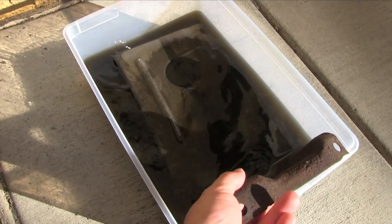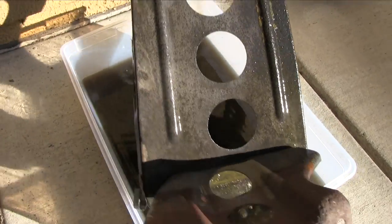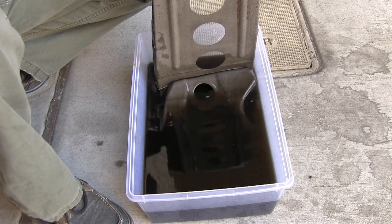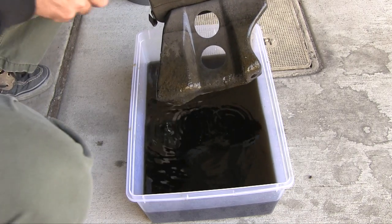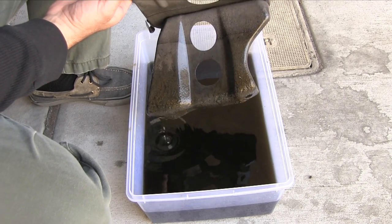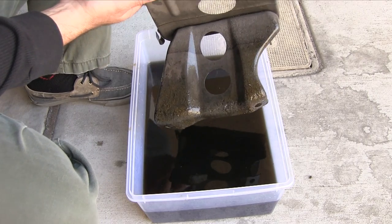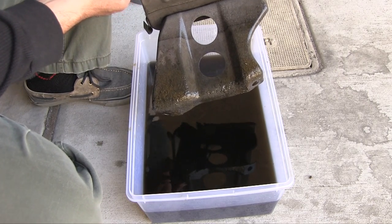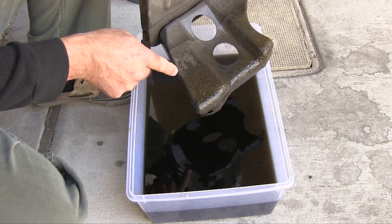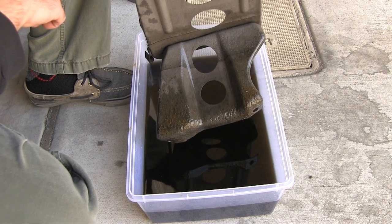Let's see what we got here. Wow, that's looking good! Turning this around — the Evapo-Rust has turned black, which means it's pretty much spent. You can still see some residual discoloration rather than bare metal, but for the most part it's going to be okay. The reason I'm good with this is because I'm going to use POR-15 silver, and in order to do that I have to hit it with metal prep first, which will take off any last bits of paint residue and minor rusting.